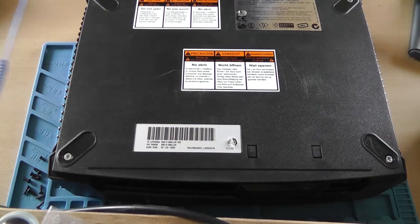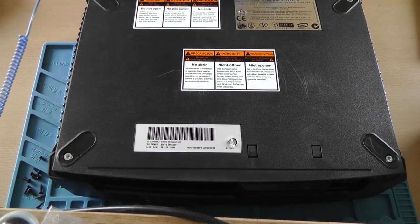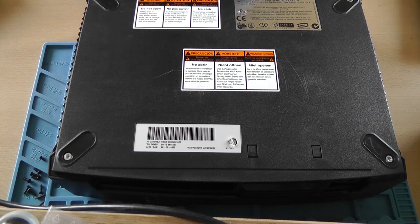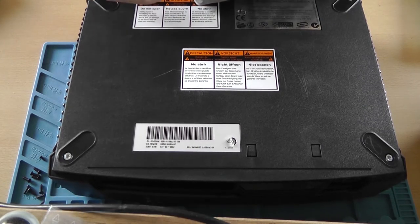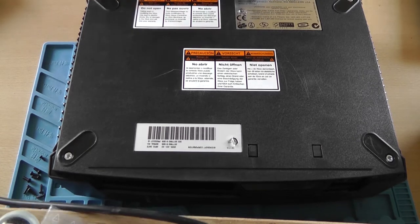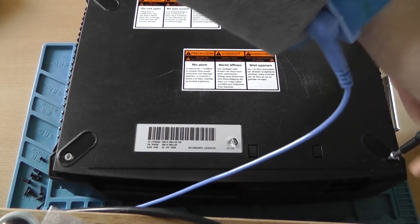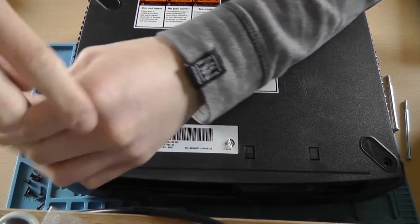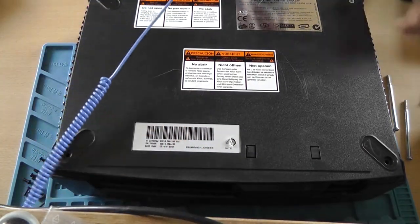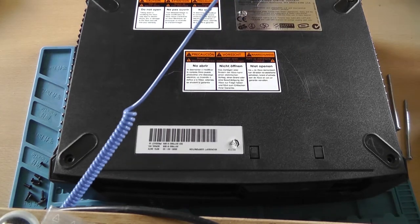After you've installed the firmware, I think it's a good time to open the Xbox in order to get the old drive out and to get the connectors out that might be in there that we need. So take out the usual screws. Now, note that I'm connected to an anti-static wrist band. That's just because I'm wearing woolen socks. It's not really necessary. But don't forget to take out your DVD dongle thing.